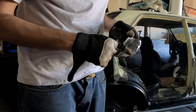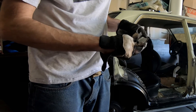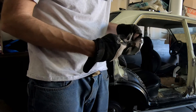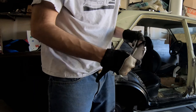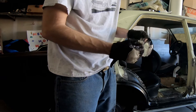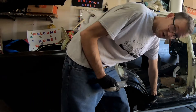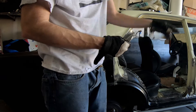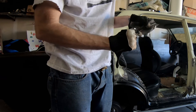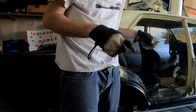It's not a pretty patch panel, but all of it's there. I'm going to tack weld along this line here, then use a hammer and a punch to tap it out to the inner rocker. This is just to keep debris from getting into the inner rocker. I'll tack it in a couple of spots and then seam seal around the edges so moisture doesn't get inside. I just need it flush — a couple of tack welds and then seam seal it.